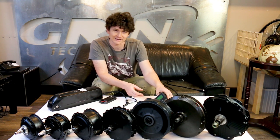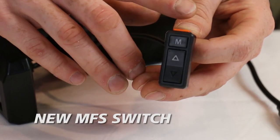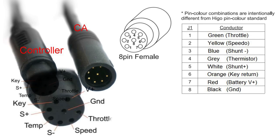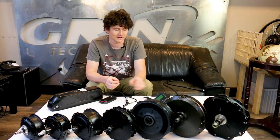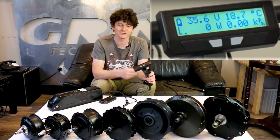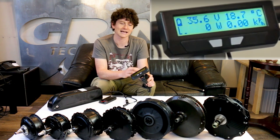It's also an 8-pin contact rather than 6 pins, and those two extra pins allow us to bring more features to the Cycle Analyst handlebar. One of those extra wires brings the on-off power switch to the handlebar, and the second one allows us to pass the motor temperature signal up to the Cycle Analyst without an additional cable run. So if your motor has a built-in temperature sensor, you'll see that temperature display on the Cycle Analyst with no extra cable runs required.